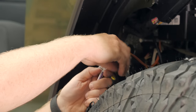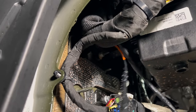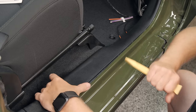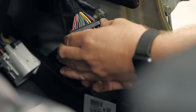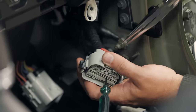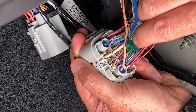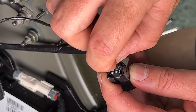At this point we can go ahead and route this third leg of the harness down behind our fuse box, routing it through an existing grommet in the firewall. Moving inside of the Jeep, we'll need to remove the glove box as well as the passenger lower kick panel. Using a fish tape or coat hanger, poke through the existing grommet in the firewall and pull that leg of the harness through into the passenger footwell area. Here you will be making one connection into a factory existing connector — follow the supplied instructions to make sure you're removing the correct wire. You will need some pin tools to help get that wiring out of that factory connector. We'll be replacing that with the orange wire in the new auxiliary switch wiring harness.